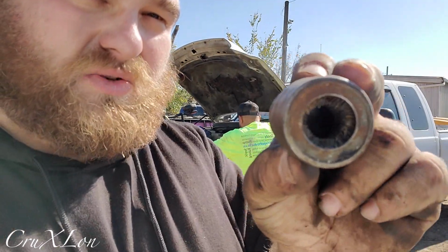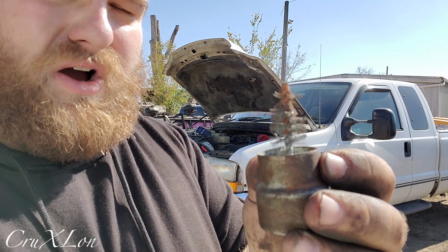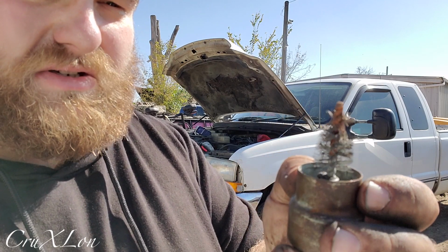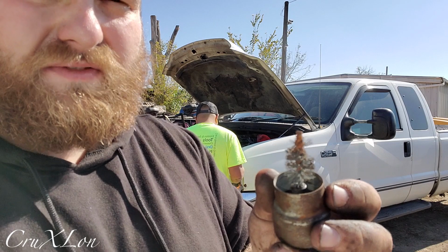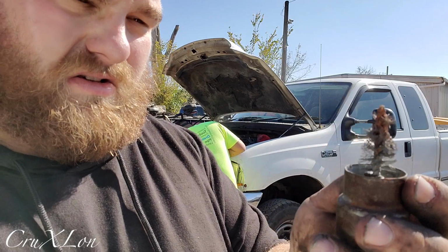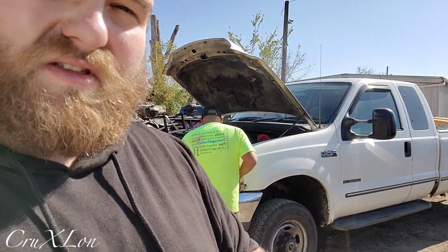On the other side, I don't know if you guys can see, are those little steel bristles. It goes in the terminal, and you squeak it. And then this one's good for the other connections, the eye connections, and it gets all the rust and all the gunk off the connections. I know a lot of people use sandpaper, but I think it takes too much off the actual connections and digs into it too much. This gets all the surface rust and surface gunk off. It's something I've always used. Cruz has never seen it, so I thought that was pretty cool. This might be a Jersey thing.